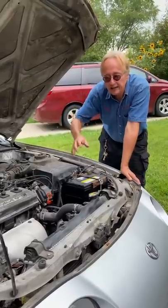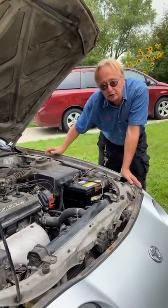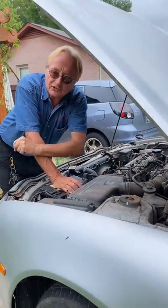If all four wheels are dry and none of the hoses are leaking, it usually means the brake master cylinder is going bad. They'll often leak inside, so you won't see the leak because it's internal — but it's still just as dangerous.